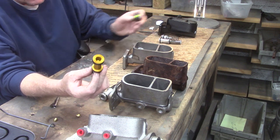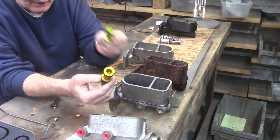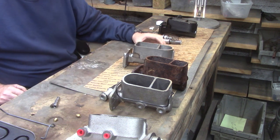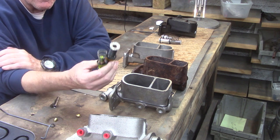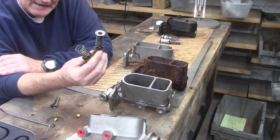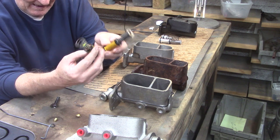We have to make our own pistons sometimes — these are made by us, just like everything else we do. Pretty much everything we have comes off our own property, one of three locations. Pretty nice colors — I get to choose the anodizing. Now I want to explain something: originally these pistons were anodized. The reason the aluminum was anodized is to prevent it from corroding and degrading — the anodizing gives a hard, semi-hard coat to the outside. That's why you get the colors; we're not doing it for fun.